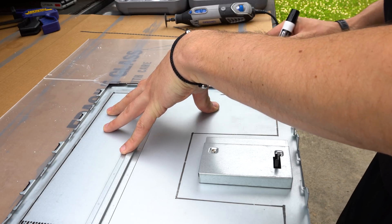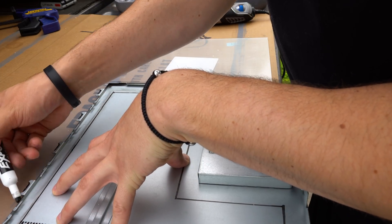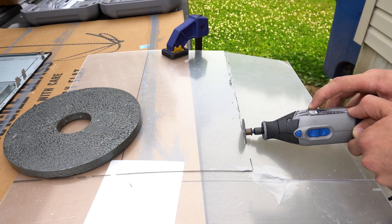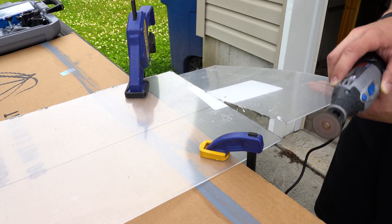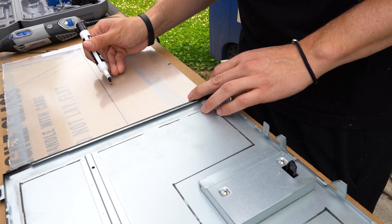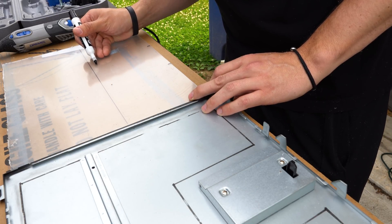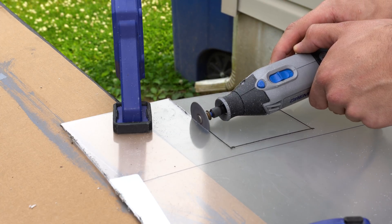After the new tracing, I decided to switch to my Dremel, which I hadn't actually used before, and this ended up being a much smoother cutting experience. I had to be very careful cutting around the part I had shattered, but after a couple of minutes — and plexiglass dust covered everywhere — I got the cut I needed. Then I had to measure out the handle opening; I eyeballed it again, traced it out with a dry erase marker, and cut it out with the Dremel no problem.